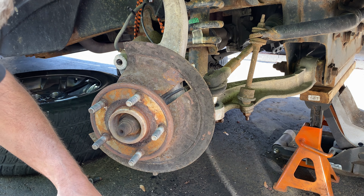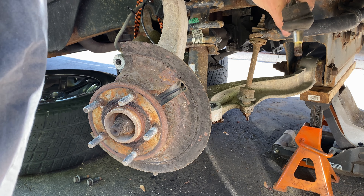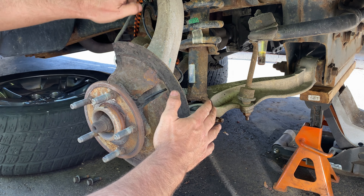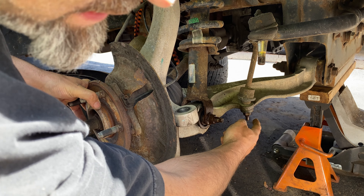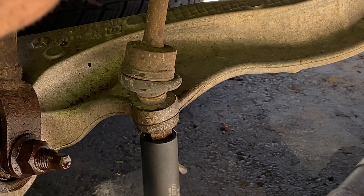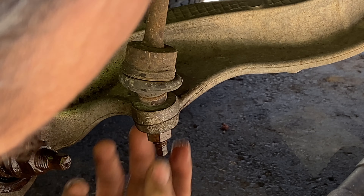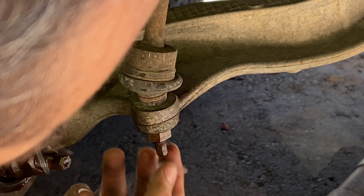You can see straight away that the cables are getting too tight, so you want to get that over there and get it tied up. The disc is now free to come off — it would just flop about anyway so we'll remove it. The tie rod looks like it wants to pop off already — put that out the way. All that's holding the assembly on at the top is that bolt there, but it's still going to need to come down a bit. That's why we need to take off the sway bar drop link — that's an 18 millimeter.